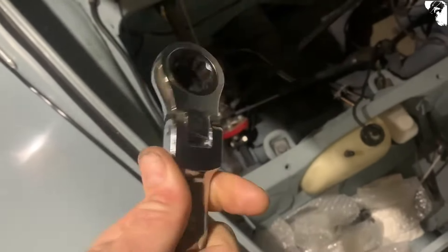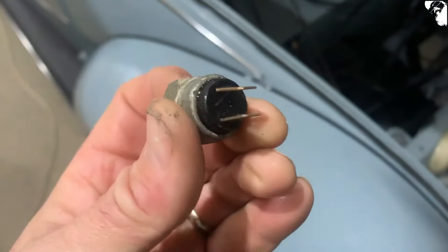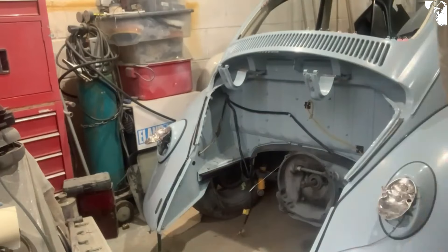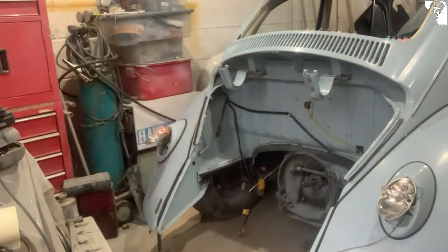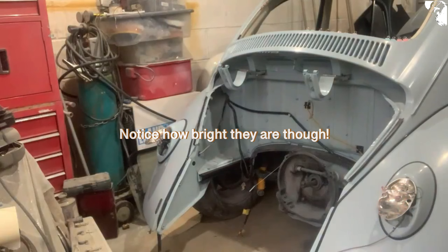I had a little bit of difficulty accessing that brake switch just because of the angle of it heading downwards to the pan. The switch itself is a 22mm, so I'm going to try this angulated ratchet spanner. Talk about a turn at a time — that hard brake line is in the way there. That did the trick for accessibility. That's out and I've got the new one to try. There's the old one. I'm hoping it was just a bad switch.